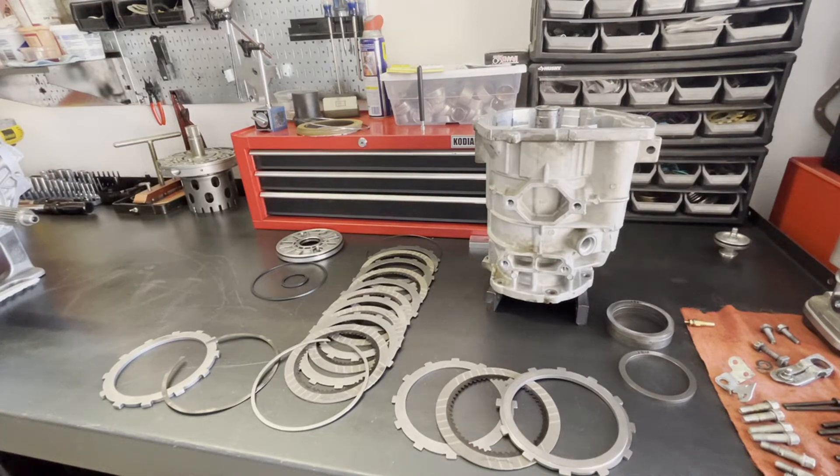I'm going to revisit the overdrive section, in particular the overdrive brake clutch stack-up, and talk about the differences between the 46/47RE's, 518, 618, etc. and the 48RE diesel application. Down the center is everything that is common to both the 518/618, 46/47RE's, and the 48RE diesel. On the left side are things attributable to pretty much all those transmissions except for the 48RE.